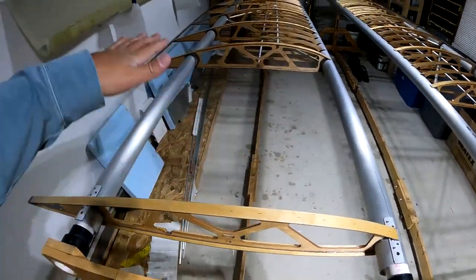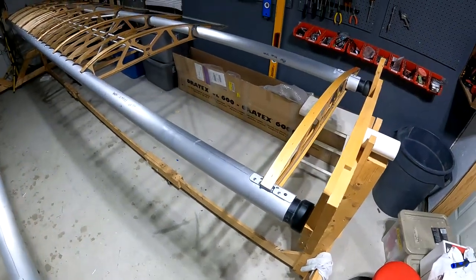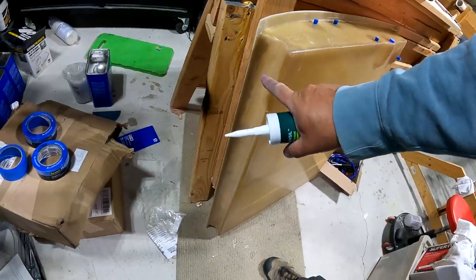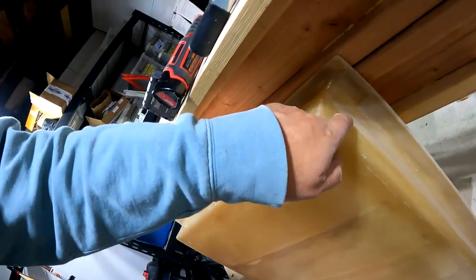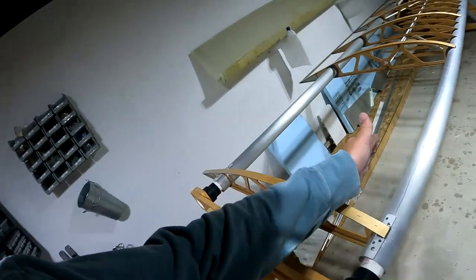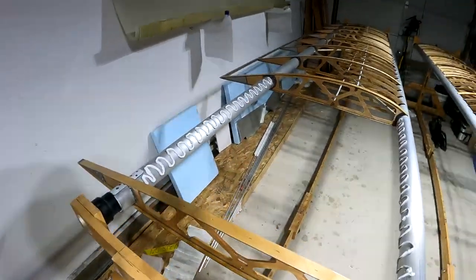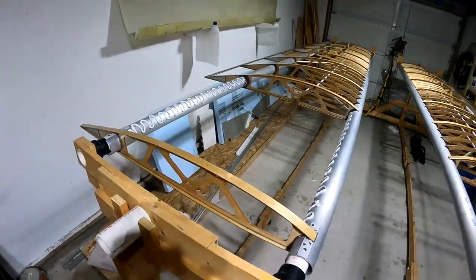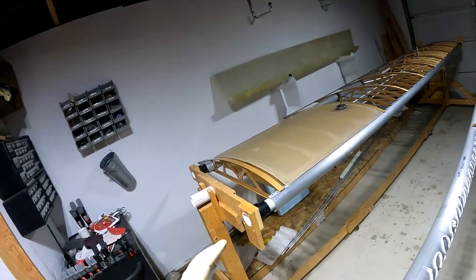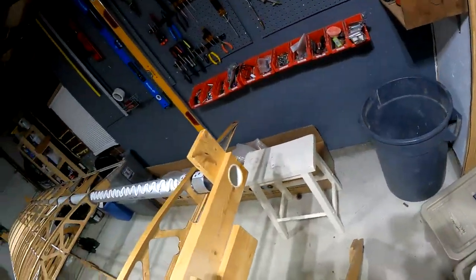I have my adhesive called out in the manual. The manual has you do a wavy pattern that is three-eighths of an inch wide. Then you button the tank in at the front edge, drop the rear edge down, and clamp it lightly. I've had these tanks in and out of here a dozen times — it's not going to take much clamping. I used 220 paper per the manual on the bonding surface and cleaned everything up with denatured alcohol and a red Scotch-Brite pad. There is the left wing — tank is in position.